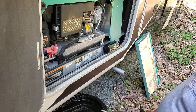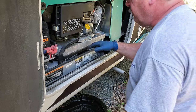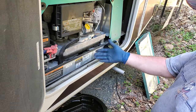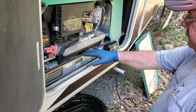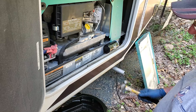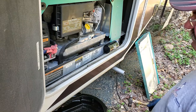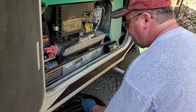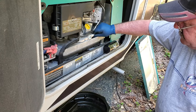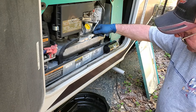Normally I don't do this, but I'm going to put a hole in the bottom of the filter so it drains before I remove it. Because right around here there's a rubber grommet to keep the weather out of this compartment — I could just take the filter off but the oil is going to get all around here and I'd like to avoid that. This here is where you drain the oil out of the engine — pretty nice that they put this on here with a little valve.